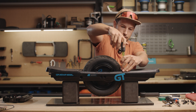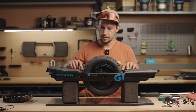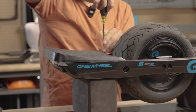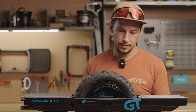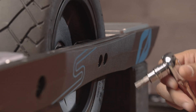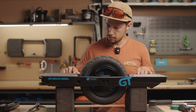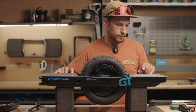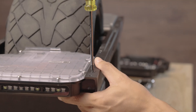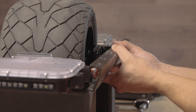We're going to take the fender delete off, then take the foot pad screws out. Next, take the left rail off — the one with the battery cable. Then take the rail screws off that are connected to the controller and battery module. As we take the controller module screws out, just brace the bottom of the controller, holding it up to the rail.